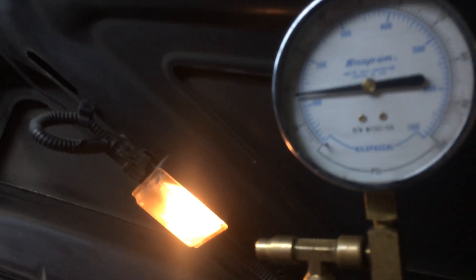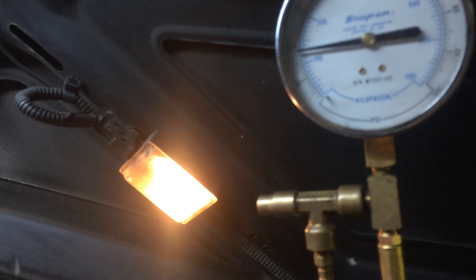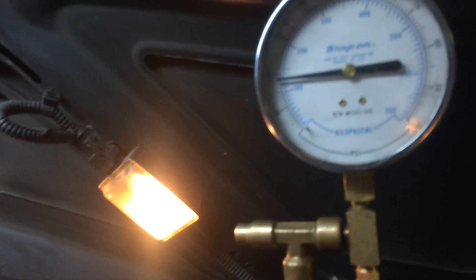Pump the starter — and there you see voltage on this pump now is at 12 volts. You can actually hear the pump running and we have about 18.5 to 19 pounds. That is pre-filter, at the outlet of the pump.